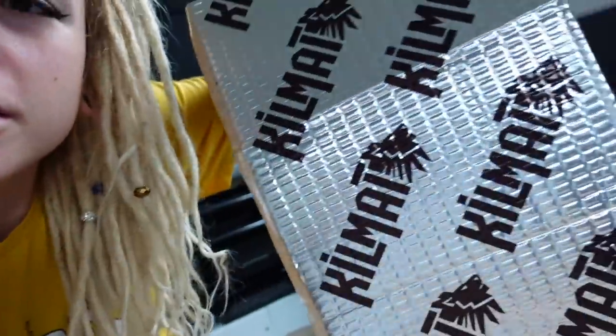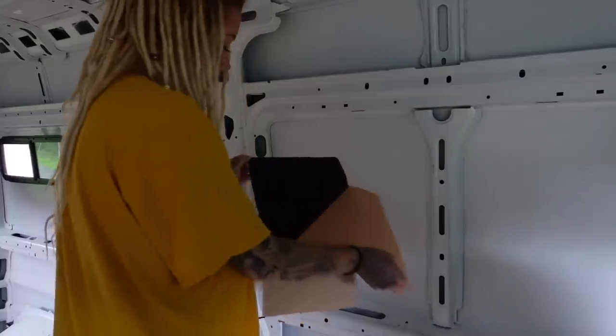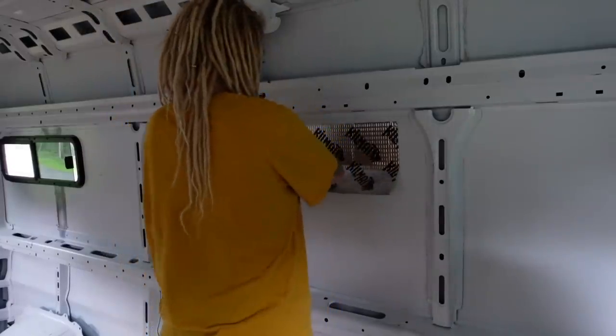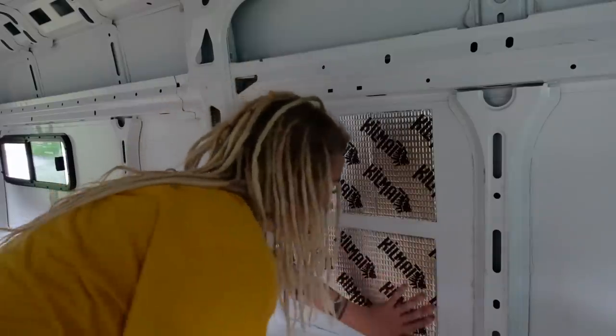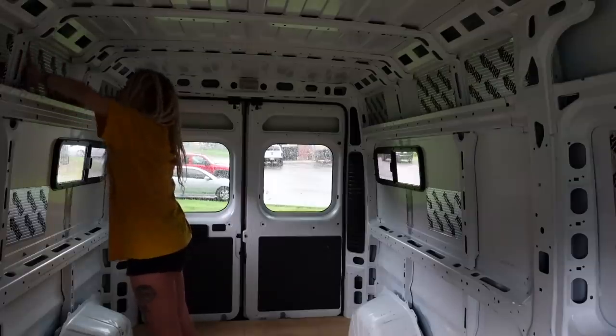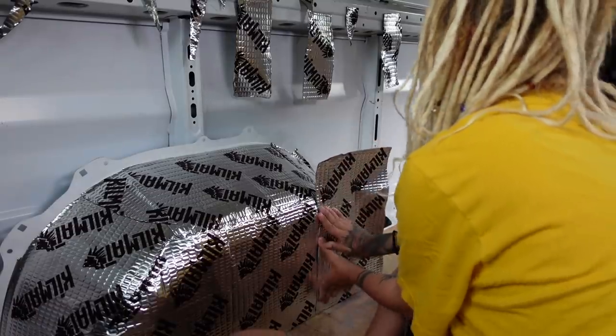The following day I put in this sound deadening mat — it's by Kilmat, I got it on Amazon. It's sheets of material with a sticky side, and I'm going to be sticking them to the walls of the van. The purpose of sound deadening a van is basically to reduce road noise. When the van is running it can be very loud because essentially the van is like a big tin can. But with the sound deadening mat on the walls, the sound is muffled significantly, making it much quieter while driving. It'll also help when I'm sleeping to quiet noise from outside. I made sure to cover the wheel areas the best because that's where most of the noise comes from.